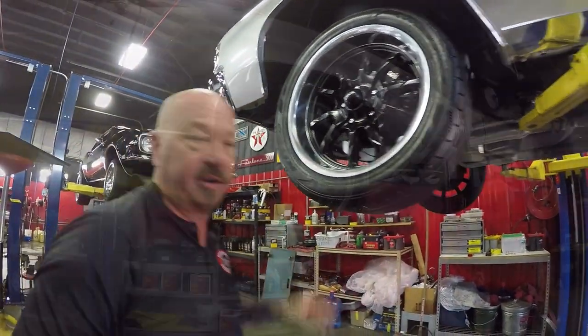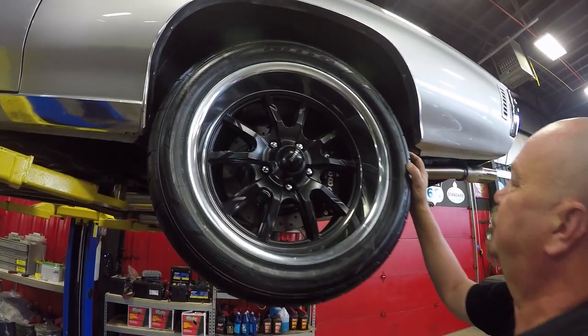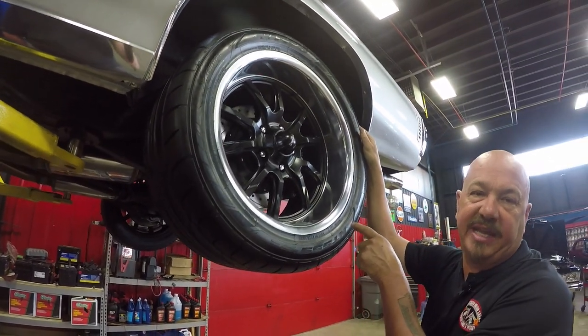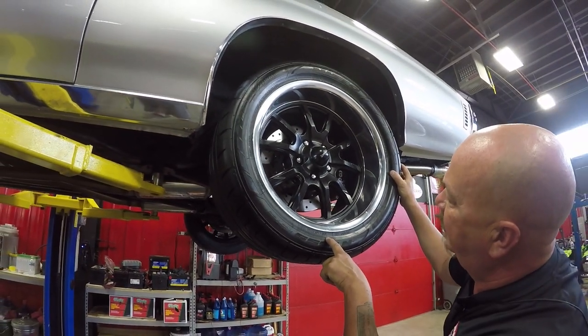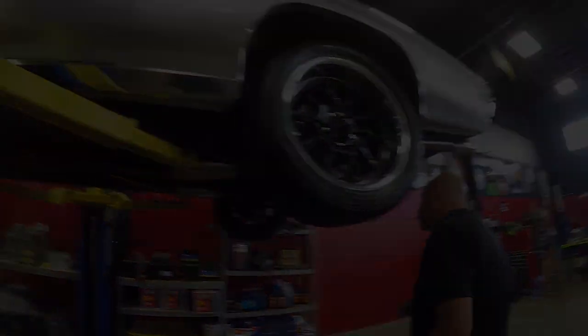Let's check the rear. All right, out back here, we got same good looking wheels. Of course, a little wider. We got four piston Wilwoods back here. And right around a 3.73 gear in there too. And it is an open rear end. 295/40/18s. Let's get under the hood.